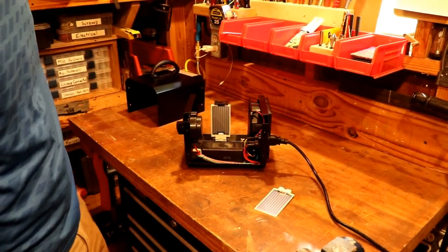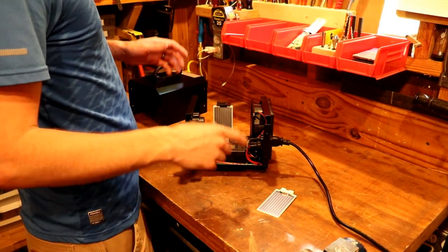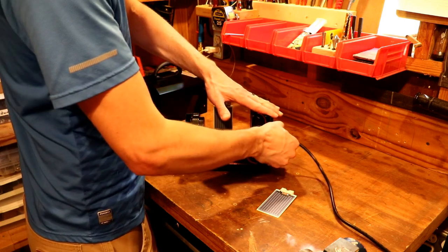You don't want to breathe O3. I'll link a video here covering the dangers of ozone with a more detailed explanation. So this is a corona discharge ozone generator — this is what you're going to find more in the lower-end homeowner models. When you get into the higher-end commercial models, they're going to be mostly the UV light versions. This plate will wear out; contact the company, they'll send you a new one, and it's pretty simple to replace.